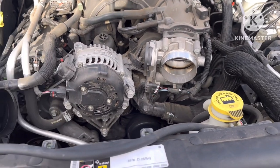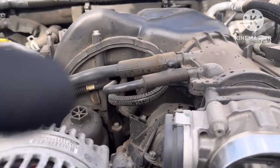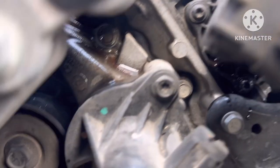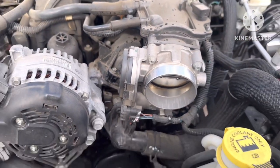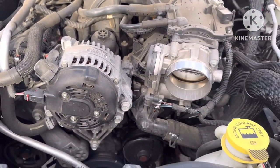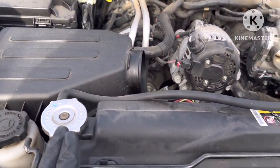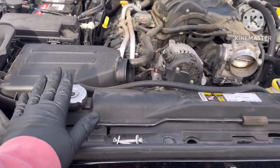I'll grab a bucket and put it under there. There are two bolts you have to take off the thermostat. There's one obviously right there — that is a 10mm — and there's one down there. I already loosened them up; you can tell it squirted out a little bit because it's pressurized. You can either take off the radiator cap and drain the radiator — I did pop the cap.